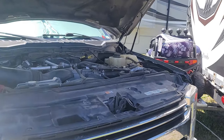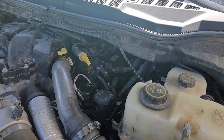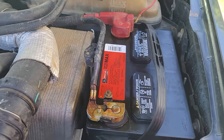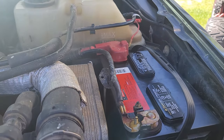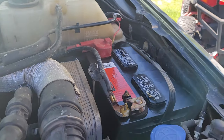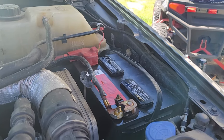The issue I've been experiencing is a crank no-start on this 2018 with a 6.7 turbo diesel. What I have done so far: I had the batteries dropped out and ended up having to get new batteries. These are brand new batteries on both sides. I cleaned them up and put this anti-corrosion spray from NOCO to help. These are lead-acid batteries, and they have a bad habit of venting sulfuric acid and corroding all the metal around there. That did not fix my problem.